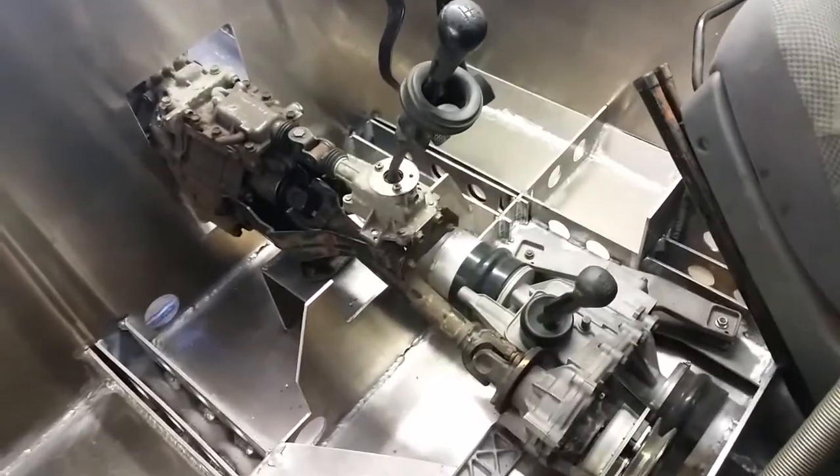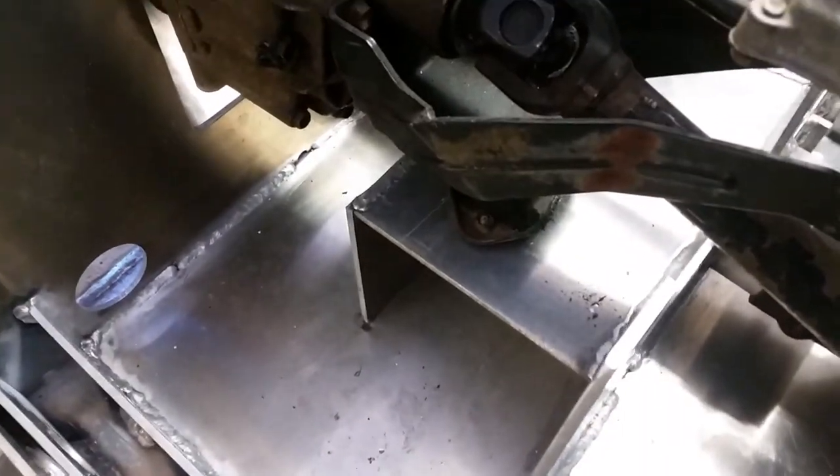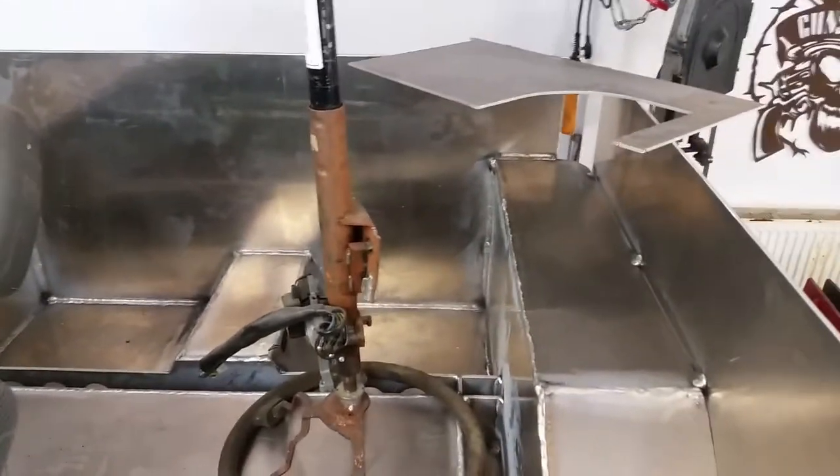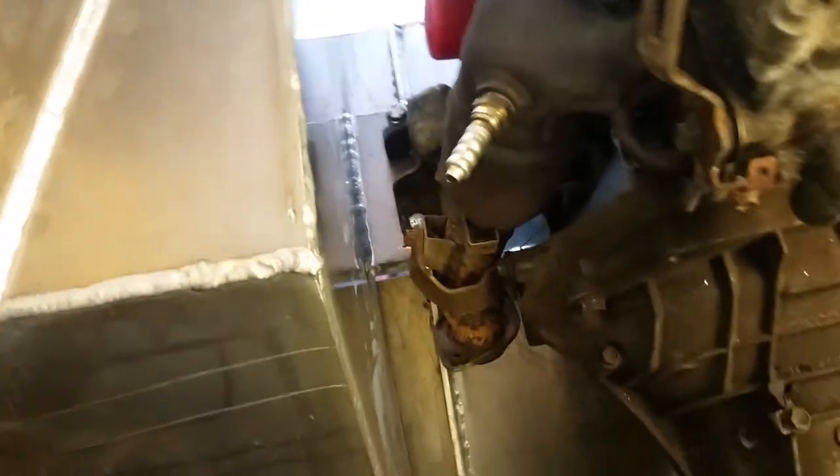Right, another very quick little bit of video. Got everything in its final sort of mock-up, got the gearbox mount in there, all transfer cases all mounted up, all the major bits got the sides sort of tacked on, and yeah, it's really getting somewhere with it now. Most of the major bits are done, most of the insides welded, the engine mounts in there as well with that 20mm thick alloy both sides, and I'm just gonna pull the engine out now.